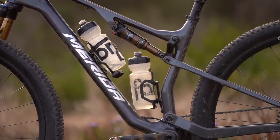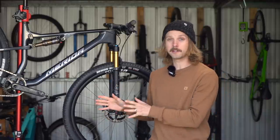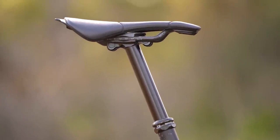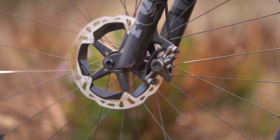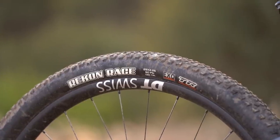The carbon swing arm is identical throughout the range. Price on this bike is $9,999 Australian dollars. There's Fox factory suspension with a 32 Step Cast fork and a Float DPS shock, a Fox Transfer dropper post — Kashima model on production bikes — a Shimano XTR 1x12 drivetrain paired to Race Face Next SL carbon cranks, and XTR race brakes. There's also a DT Swiss XRC 1501 carbon wheelset wrapped with 2.25 inch Maxxis Recon Race tires. Confirmed weight for our test bike is just 10.52 kilograms, weighed without pedals and with the tires set up tubeless.